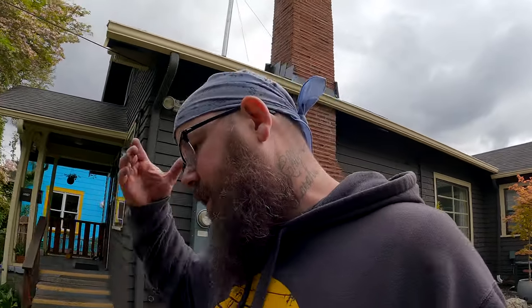All right, so it passed the bump test finally. I kept having to add air and bump it. It would go negative camber, I would add air and bump it again. But when I'd add air, I had to lift up on the wheel well so that it would go. But I think we're sitting pretty good right now. I'm going to do a short jaunt, check my pressures, check the cambers, and if we're still holding good, I'll do a little bit longer one.